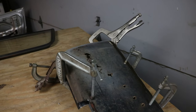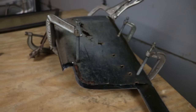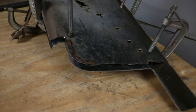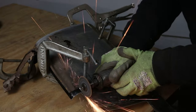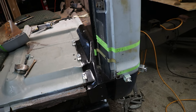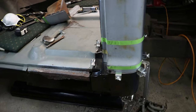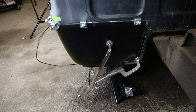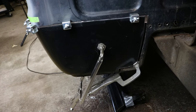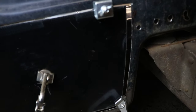The way I'm going to fit this cab corner — I have my replacement panel underneath and my crappy rusty cab corner on top. I'm going to take out my cutoff wheel and cruise along that line all the way through. I cut up the cab corner using the old cab corner as a template, which worked really well. But I just told you guys to work one side at a time — and what didn't I do? I didn't take my own advice, because if I would have, I wouldn't have that gigantic gaping hole right there.